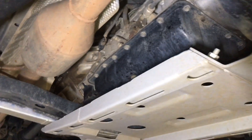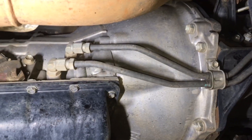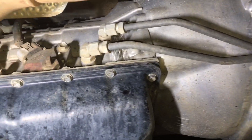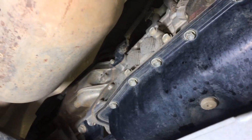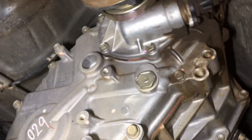The good news about why I love this Hilux: the later Hiluxes — around 2013-14 — got the 5-speed auto, the A750F, same as what we see in the Prados, and it's bone dry. It's going to work awesomely behind a 1KD in a Hilux. You've also got the bigger Prado brakes that came out around 2011, the latest injectors, pistons, DLC — probably 110 pistons, full DLC injectors — the last of the best, absolutely, in a 5-speed auto. This is what I'd be after. After this video comes out I think these Hiluxes are going to go up in value.